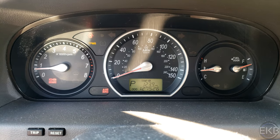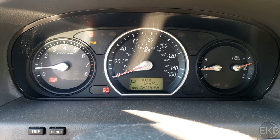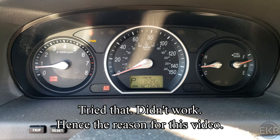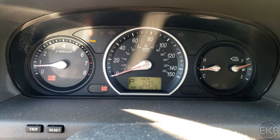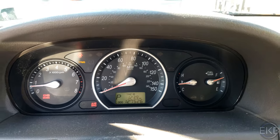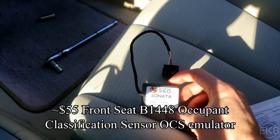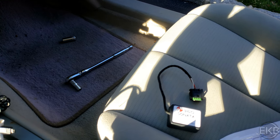Now, there's an easy fix which just involves you disconnecting the battery for a few minutes, and if you have the scanner, just clearing it and see if it comes back. If that doesn't work, try the easiest thing first — which is why we do that — but if that doesn't work, then the next step, which is what we're going to be doing, is to buy this emulator. It's about $60 off of the website Airbag 360 — links will be in the description.